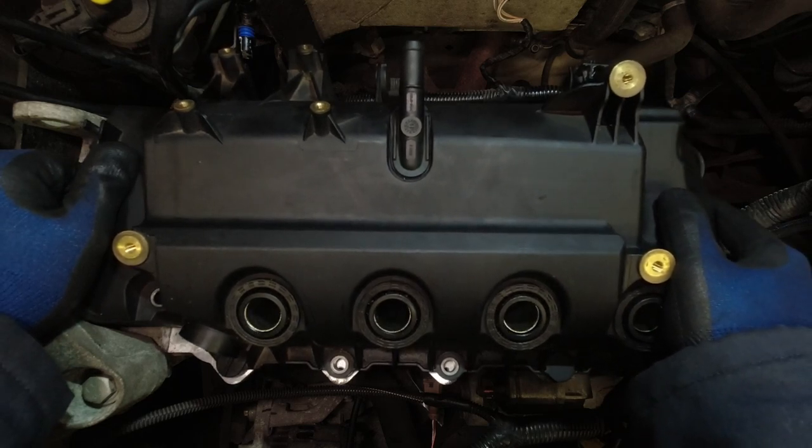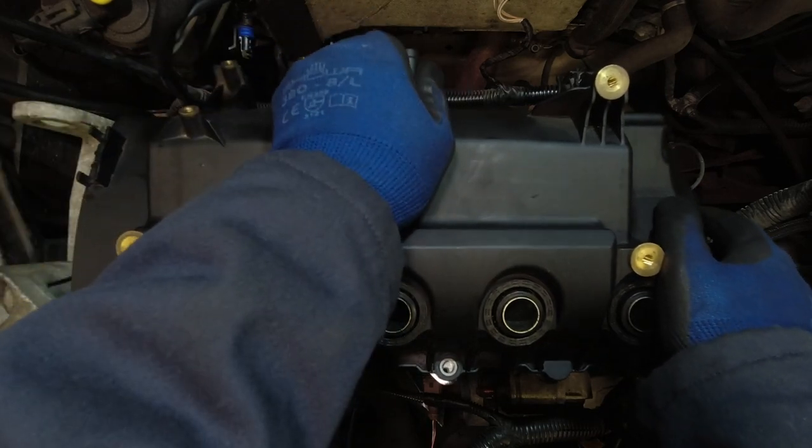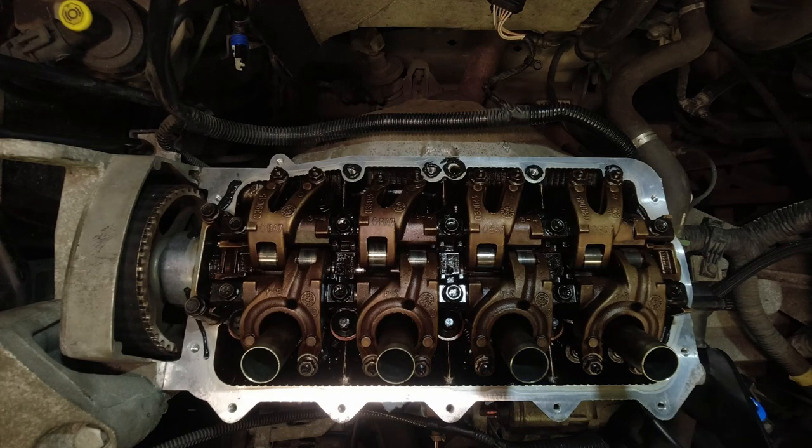You can see you're lined up with your spark plug tubes, and then you can just drop it into place like that. So as you can see, difficult, but not impossible, but it will make it very difficult to lay it down square on so you don't smear your silicone beads. That's why I highly recommend getting some new spark seals, popping out the old ones, and refitting like this without them in, because it gives you so much more room, then we'll put them in after.